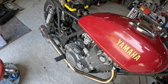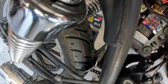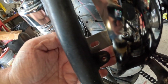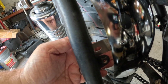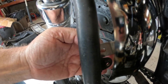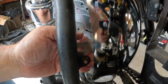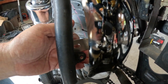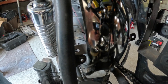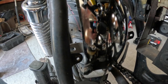The back one, on the other hand, bolts up perfectly at the back, but here at the front the mount on the fender does not line up with the mount on the frame. The mount is also too wide to fit down in the frame. So I'm going to take the fender off, drill the rivets out, put these mounts back in the frame where they go, mark where I need to drill new holes, rivet the fender back together, and then do something to fill in the other holes.